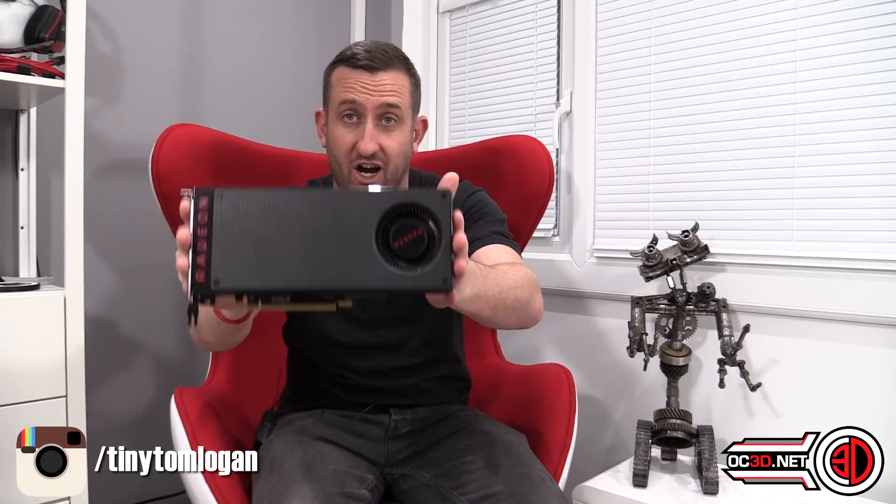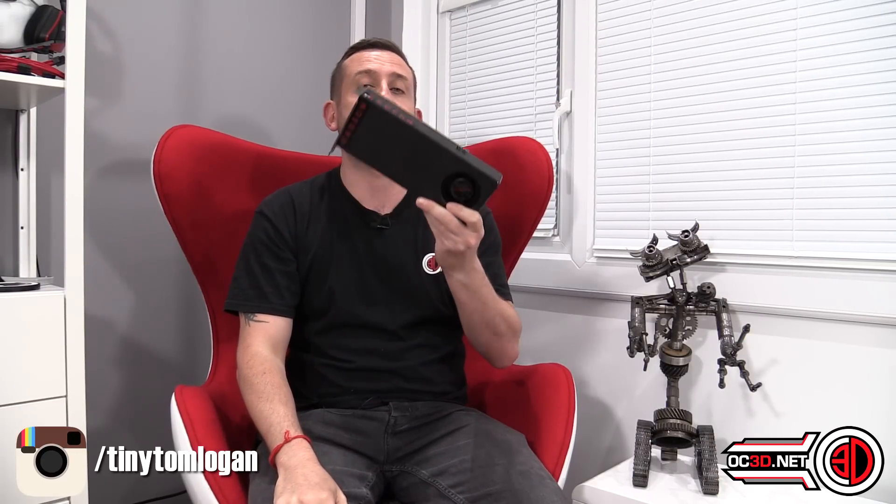It was like, okay, this is what we'd be expecting. With the overclocked card I was getting just shy of 17,000 points. Then I put the stock card in - no overclock at all - and literally all I did was change the power slider: 16,888 points. It was within spitting distance of the overclocked card. Tried it with all the others - exactly the same thing.